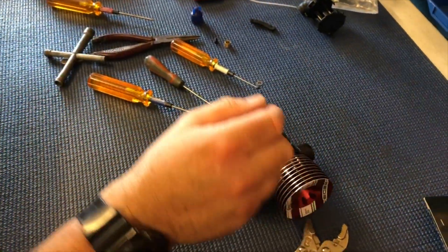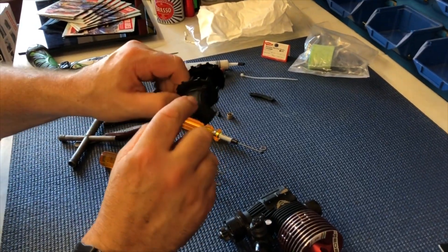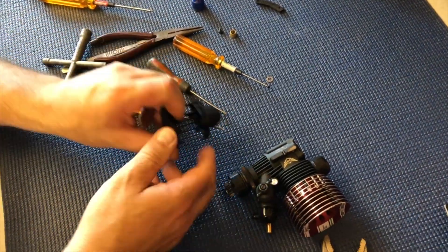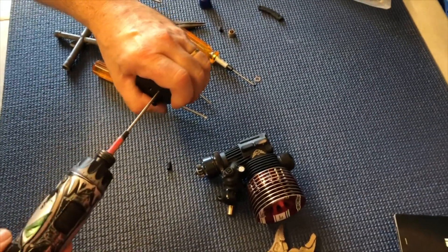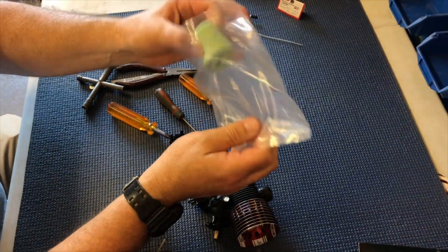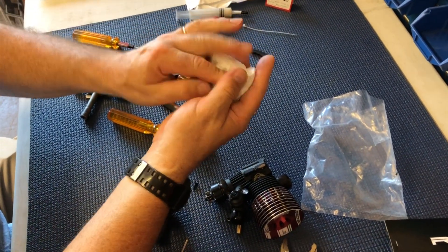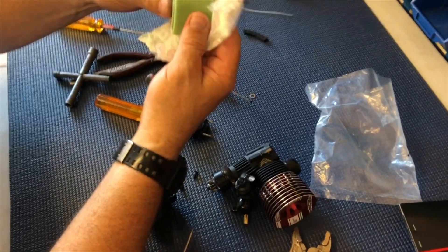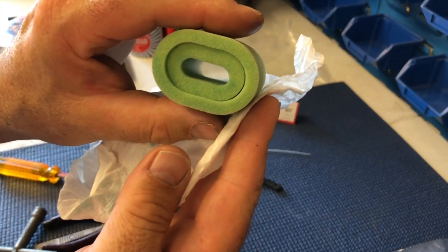So once we've done that we get onto the air filter. As they say in Blue Peter, here's one prepared earlier — I've super-glued the inside and put a nice zip tie fitting around it. I always put the knot at the top because the fuel line's going to run through there and you don't want the knot rubbing against the fuel line. You should always pre-soak the filter at least 24 hours before so that all the release agent comes out. Always use a good filter oil like the Reds filter oil or Kyosho filter oil. Make sure it looks evenly coated with no speckled parts — you want to see a nice webbing, which is what traps all the dirt and stops your engine wearing.